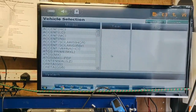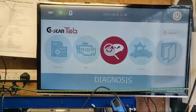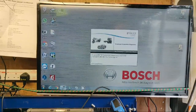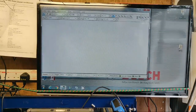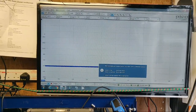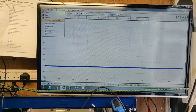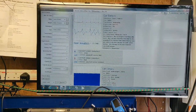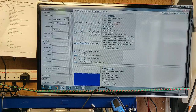Let's get onto the big screen. I've got the G-scan on, let's just power that off - we don't need that. First of all we start the Pico software. We've got Pico Automotive there, and if you go up into the top left hand corner where it says File, then Waveform Library Browser. To access the waveform library you've got to have your Pico scope connected. I'm already logged in - you can see that in the top right - with your username and password. You go up onto picoauto.com to set that up.